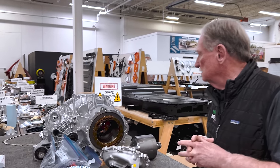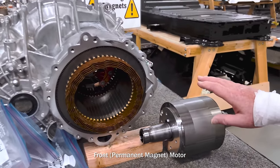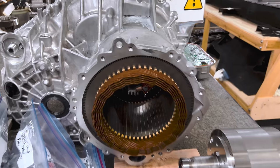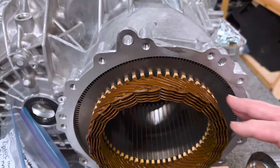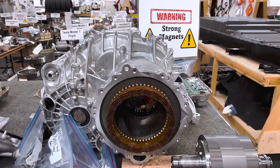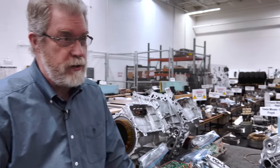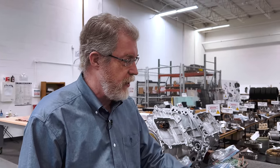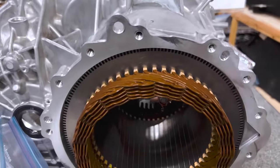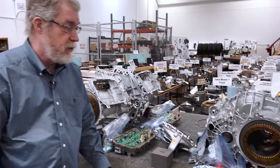The first strong point is the PM motor here. This is the rotor and this is the stator. You can see that Tesla has moved away from the woven system and gone to what we call hairpin winding. This one is a little closer to what we saw on the Kia, and since they're both 800-volt motors, that makes a lot of sense. In my first video I went into quite a lot of detail on why it's a really good idea to go with this type of construction with eight bars per slot — they minimize losses and get the best of both worlds.